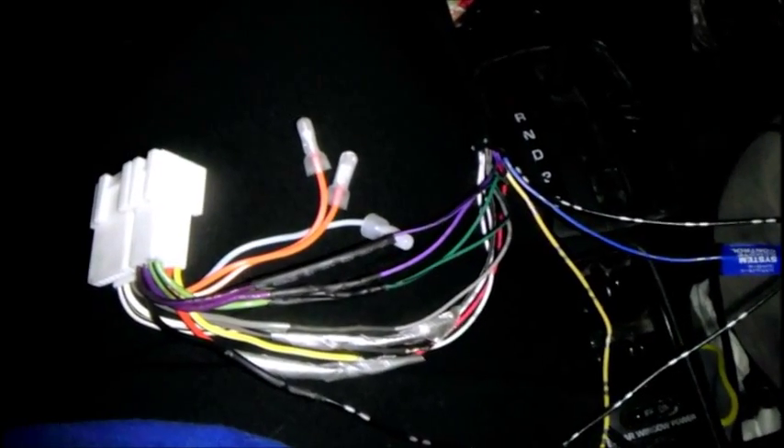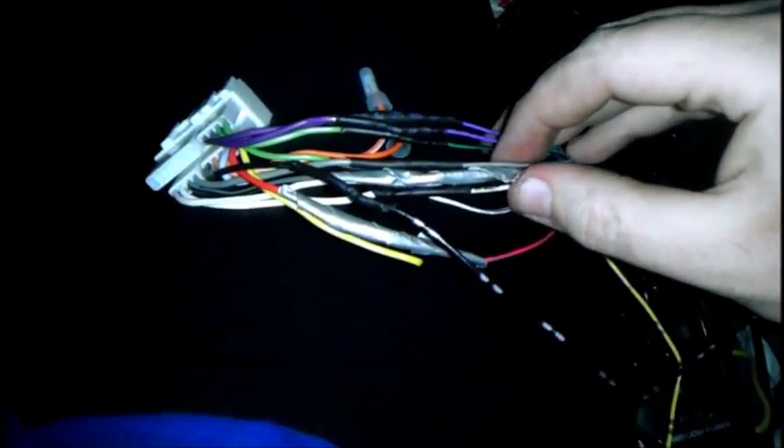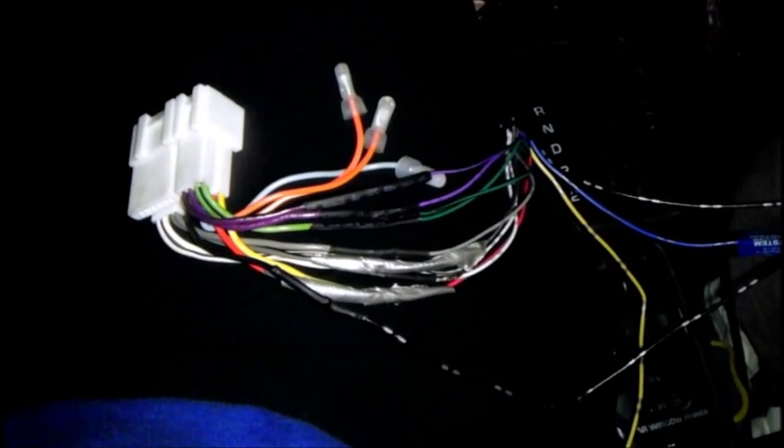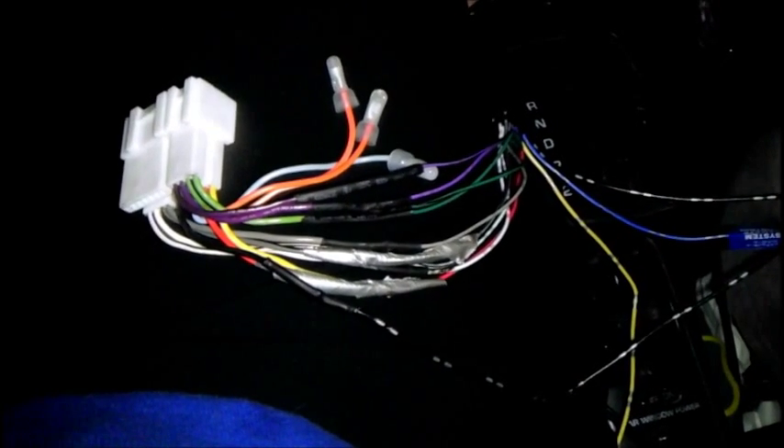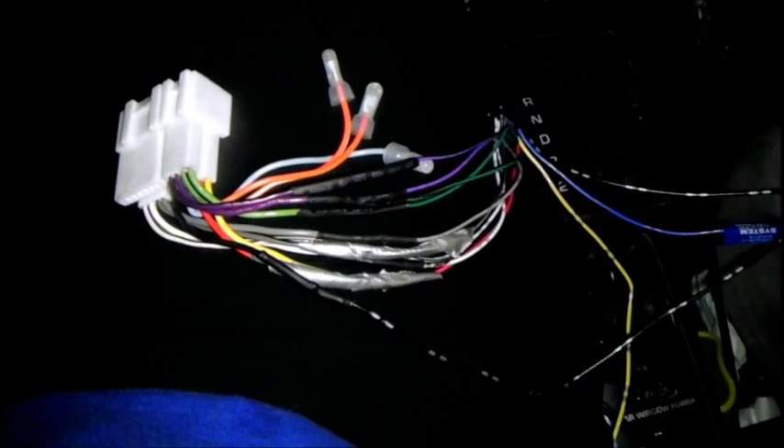We're back in the car. Harness is all ready to go after several hours of new line running. You really should solder and heat shrink wrap your connections. For the most part I did; for a couple ones I forgot the heat shrink wrap. Regarding the red wire — this is your control wire for the ignition switch, which triggers accessory and run, which is needed for your relay. So technically, I could pull the duct tape off, run another wire to that splice, solder the new wire in, solder the new relay in, and we're good to go.